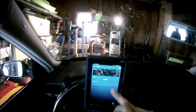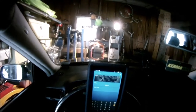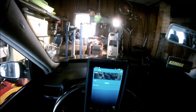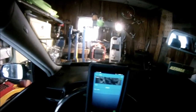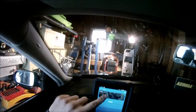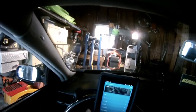It says value 0002. If you want to change that — when it was automatic, it'll say 0001 — you're going to change it to 0002 and hit the check button, the green thing down there. I'm not changing it because I already did, but you would just change that to a 2 from a 1 and hit go, and it would say value accepted. So that's all you do for that.